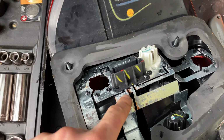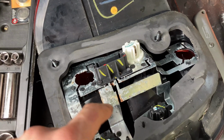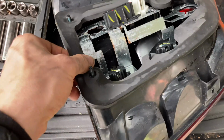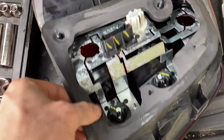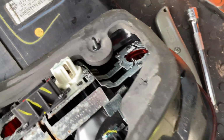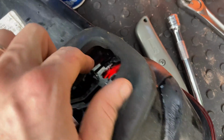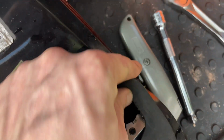And when I did so, I noticed that there was some corrosion starting to take place around this. And I knew that that was most likely because this seal, which is a very common thing on the W164, goes bad after a while. It's basically just a foam seal that glues to the back. And once it does, it basically loses good contact. You can see up top here, it's basically wet all the way through, and it's not stopping that water from coming in.